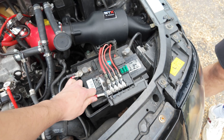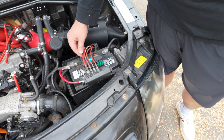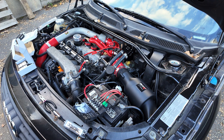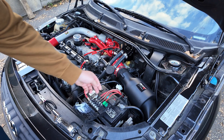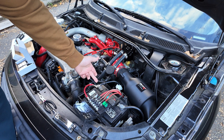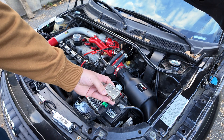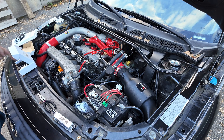This is cold, but this is still warm — and this goes to the interior fuse box. We wanted to find a new solution for this wire because it's been getting hot. Pretty much what we're going to do is replicate what we did with the alternator wire for this wire. This goes to the interior fuse box, which powers pretty much everything. This junction is already stacked to the moon, so that's why we have this — a battery terminal block that will allow us to run everything right off of the battery.